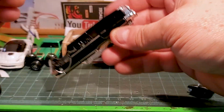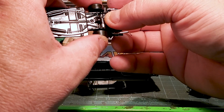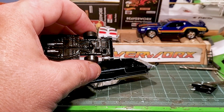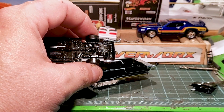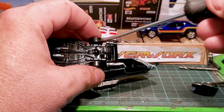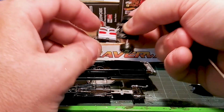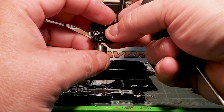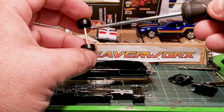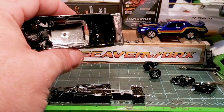I'm going to work on shortening the axle, which means I'm going to have to close the distance in there, right? Remove some material from the leaf, probably take the leaf springs out, both sides. It's only on this piece here. And then I'll take a little bit off the axle tube and everything will slide into place after that. And that should be enough to fit me inside of these guys.